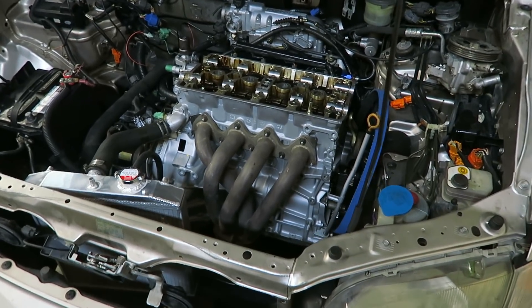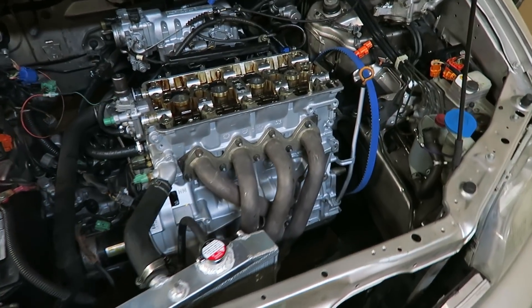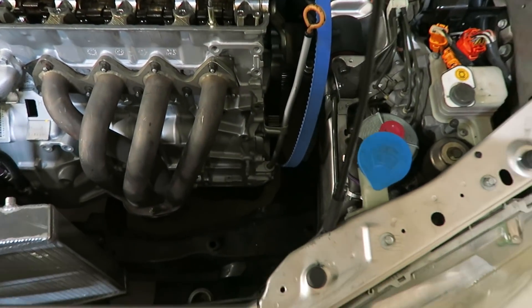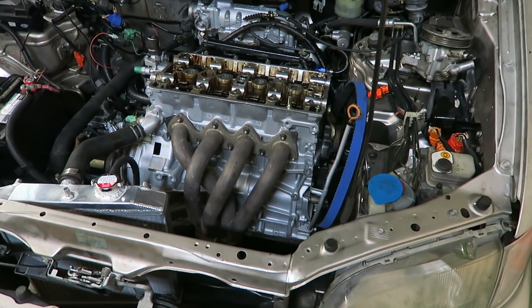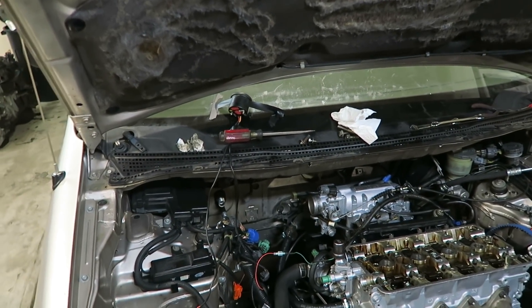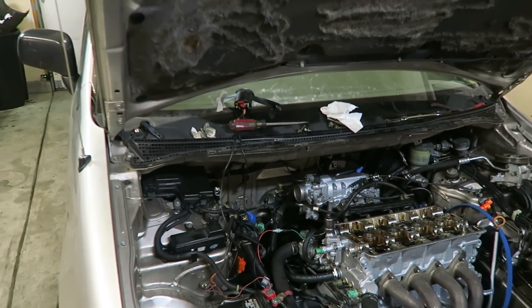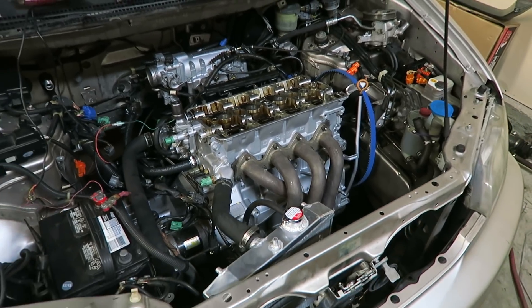When it crosses over into VTEC it drops to almost 50 psi. This video did not go as planned — I was not expecting to have to tear into the motor. I've put a couple of these together for my hatch so I have a pretty good idea of how they go together, but I'm honestly not sure what's happening. Maybe it is just a weak oil pump. If we put the shims in and the oil pressure doesn't change at all, then something is definitely up with the pump. There's also a small possibility the Glowshift oil pressure gauge could be malfunctioning, but I don't think so because it reads much higher at cold idle. We'll look into it tomorrow — thanks for watching.